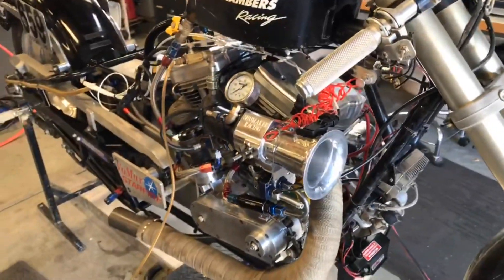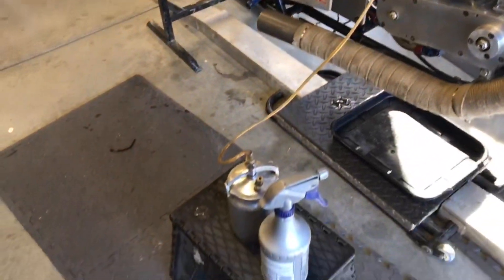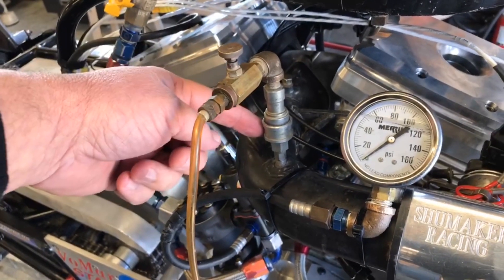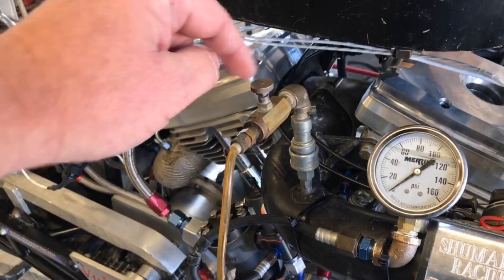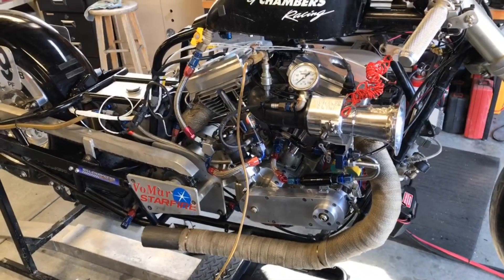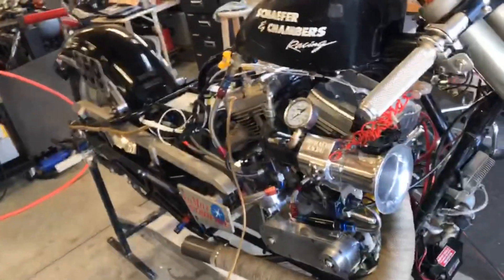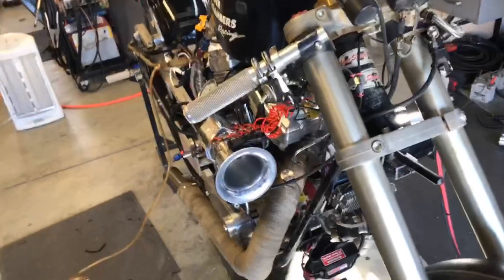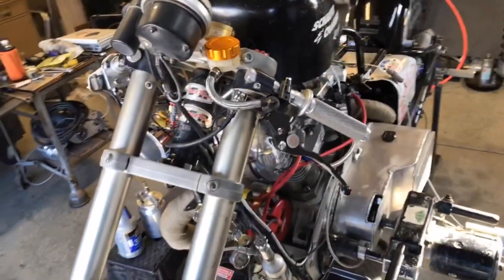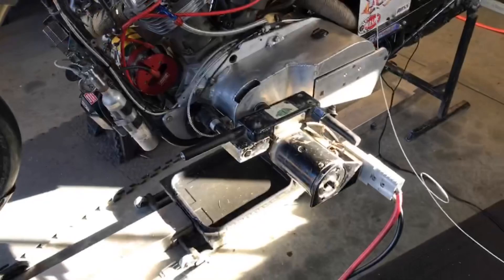The procedure on this thing is to start it up on gasoline and get it warm. This is actually a tank full of gasoline with a nipple that goes into the intake manifold. Vacuum pulls the fuel out of this tank and he can regulate the flow here to control the mixture when warming it up. Sometimes up in the desert in the winter it's in the 30s overnight, and it would be awfully hard to start on nitromethane. Also, because we're running 70% nitromethane, nitro becomes explosive by shock if you run more than about 60% compared to alcohol. So running at 70%, there is a risk of an explosion from knock or shock when starting the engine.